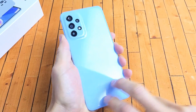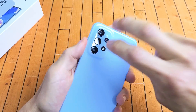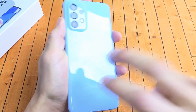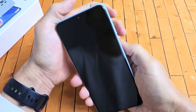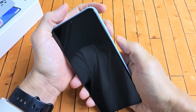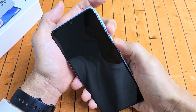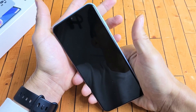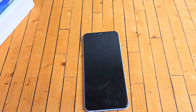Also tap all over on the back, on the sides, even all around the camera lens. Get all in there. Turn the phone over and see if you're out of the boot loop. If you're still stuck in a boot loop, same thing — restart it using the two-key combination. Volume down, power — press and hold both buttons together. Do not let go until you see the Samsung logo. Once the Samsung logo appears, let go of both buttons and hopefully you are up and running. If not, we're going to go to the next possible fix.